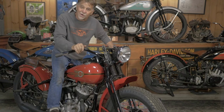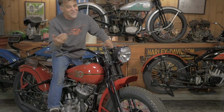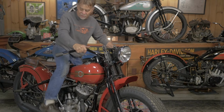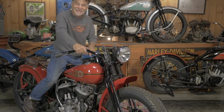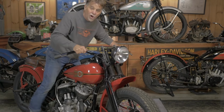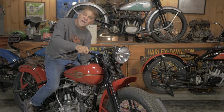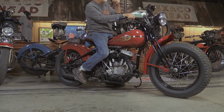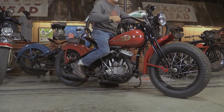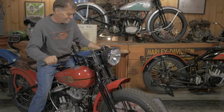Then it's a matter of relaxing. You don't have to kick a Harley really hard. You just have to push the pedal through firmly. So I'm going to give this thing 2 kicks, choke on, key off, throttle off, 2, 1 for good measure. I'm going to take the choke off to halfway. I'm going to turn the key on for the very first time, and this bike will start on 1 kick. Every time.